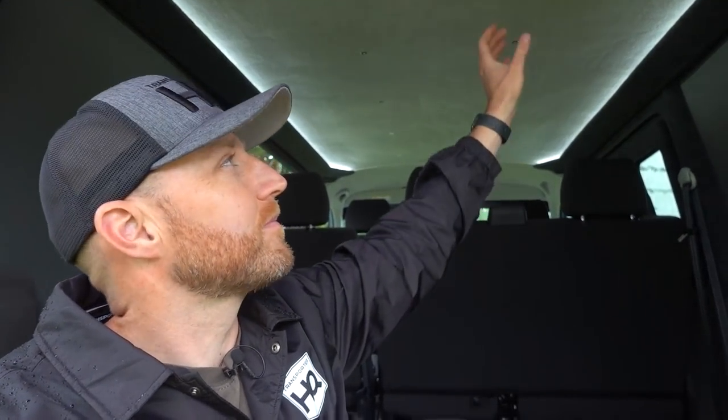Yeah, so you use the same amount of carpet here as you would have done if you were carpet lining the whole lot. Mentioned before, if you were carpet lining these as opposed to going for the leather effect panel. So it hopefully should help you understand and clear up how much you would need. From the glue point of view, it's pretty much a can of glue per meter to help you work out what you need to order. And these are obviously just clipped in with a hidden panel clip, so you can't see all the original OEM clips. It just finishes it off a little bit nicer, I think.